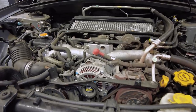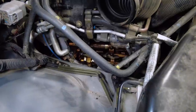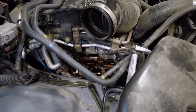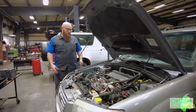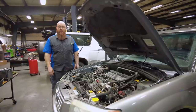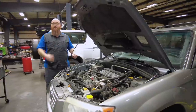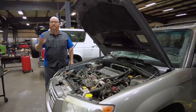It did run a little rough, and they're concerned about lack of power. We do have the valve covers off — it had a small leak from the valve covers, and also I wanted to check to make sure we don't have any rounded lobes. We're going to verify the valve clearances on the tappets to make sure everything's in spec. In the early years, Subarus are known for their head gasket issues, but this one currently does not have any head gasket issues. These are really cool engines; they're fun to work on, though the turbo does complicate things — it adds labor time because lots of pieces and parts have to come off to get access, parts that are non-existent on a naturally aspirated 2.5.